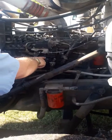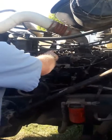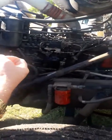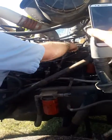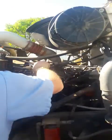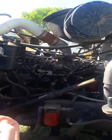Well, this has got a little bit of a leak. I'll mention that when I get back. Check your injector lines. Make sure the lines are tight, not leaking, no visual defects. And then on the end of your injector lines are your injectors. Check your injectors, make sure they're tight, not leaking, no visual defects.